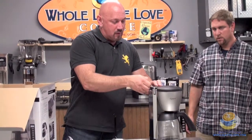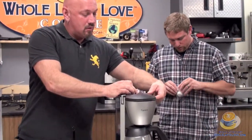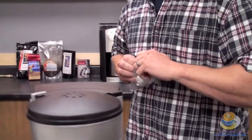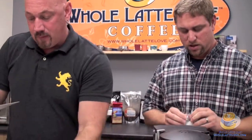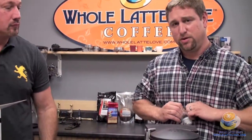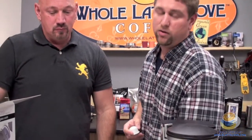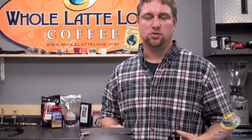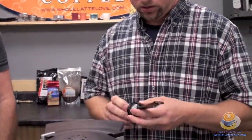I appreciate it. So first, the charcoal water filter, I definitely recommend using for a couple reasons. Number one, it just makes your coffee taste better. It helps filter out the chlorine and the impurities. It actually filters out up to 82% of the impurities in the water. And number two, it goes a long way for the overall health of your machine, keeping mineral deposits out of the internals, which can over time accumulate and start clogging up things. So it's definitely a good idea to use that.